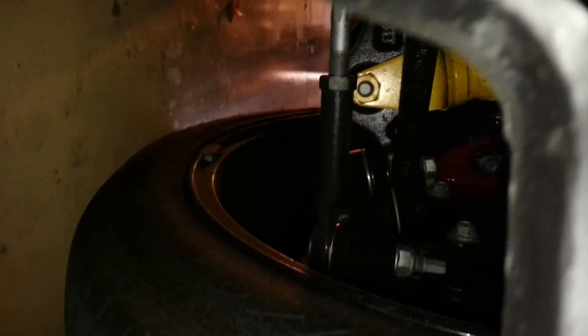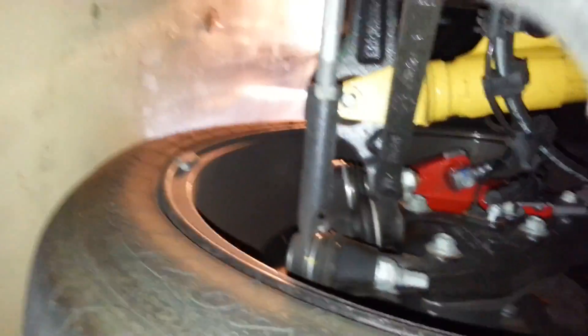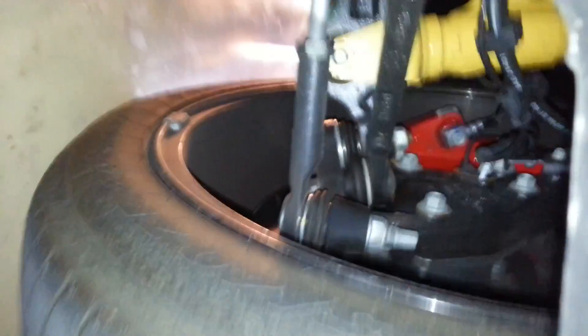I think that's probably the way I'm going to leave it, for two reasons. One, the ducts are still lined up so you can still get air coming out of the front grill and it'll go straight through to there and give you some air into the wheel well onto the brake rotor. You'll also get it coming into the air box. And not only that, but with this open in the back you can get a little bit of air through this way too underneath the wheel well, which should be relatively cool air.